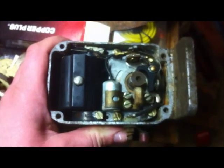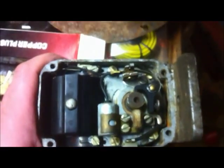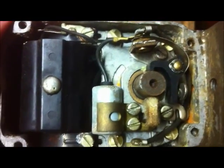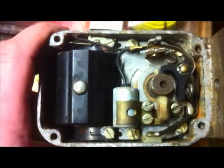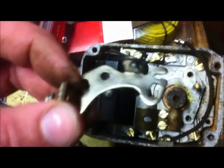I built a new spark plug wire and now we have no spark. This thing has been sitting around for a long time, and what it looks like is that the points down here are pretty nasty looking. We're actually going to take the points off and clean them up a little bit with a file, put it together, and re-gap them to see if we can get some spark. These points are pretty dirty — they're black, it almost looks like they're covered with carbon or oil.